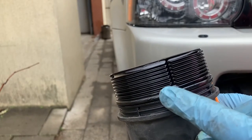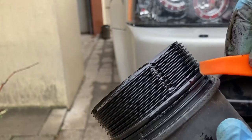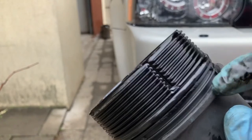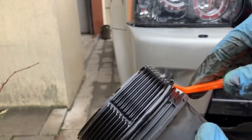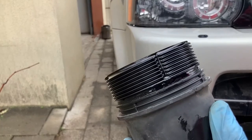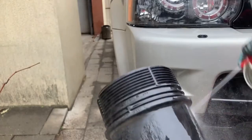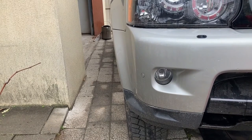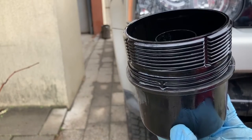You also have to discard the rubber O-ring on the filter housing cap. All new filters come with new O-rings and you absolutely must replace the old O-ring when changing the oil filter. Use an interior trim tool — not a screwdriver — to pry underneath it safely since this is plastic, and pull the O-ring out. Use some brake cleaner to clean the surface of the cap and the insides of any old oil.